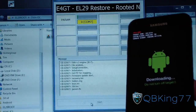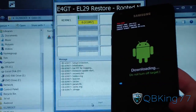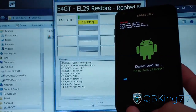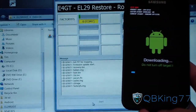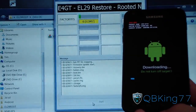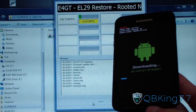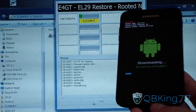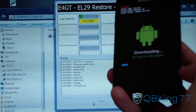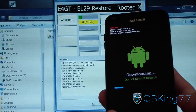It will take a little while — my guess is maybe three and a half minutes, could take longer. If you are having problems, the main reason people have issues with Odin is the cable. BlackBerry cables work the best; Samsung cables are pretty bad. So if you're using a Samsung cable, that could be the main reason. You can try reinstalling drivers, try different USB ports, or try taking out the SD card. Try all those steps first. If you have more problems, feel free to leave a comment on the video.